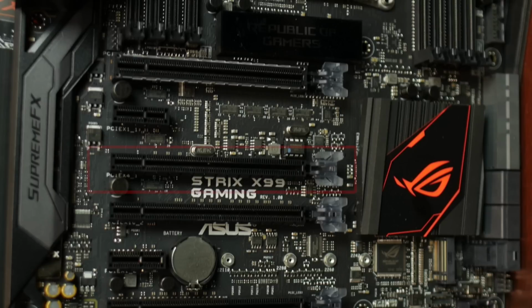And this motherboard shares resources in kind of an unusual way. Let's take a look at that. So the second PCI Express by 16 physical slot is labeled on the PCB PCIe by 4x1. So by default with the USB 3.1 controller, this slot that's physically by 16 will run it by 1, and also this by 1 slot next to the CMOS battery will also run it by 1.